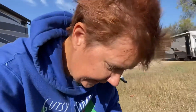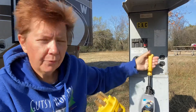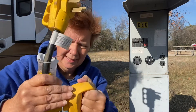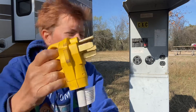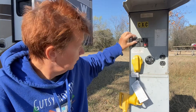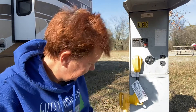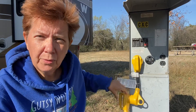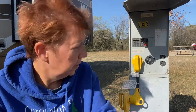This is my electrical compartment, and I've had this adapter in here for two years. I figured I'd never need it — but I needed it. Here's what I did: I took off the 30-amp, turned it all off, and with my surge protector I plugged the dog bone into the 50-amp port. Then I turned the 50-amp back on, and I'm back in business. That's how you solve it if you're having problems with the 30-amp.